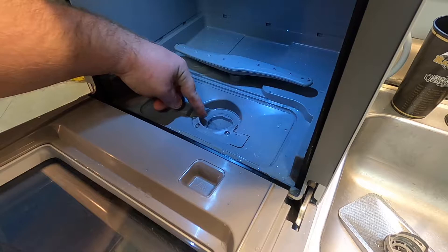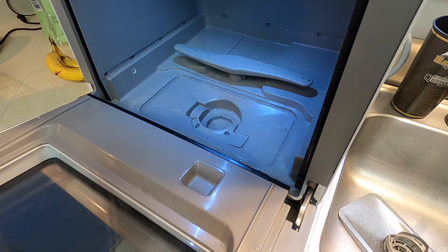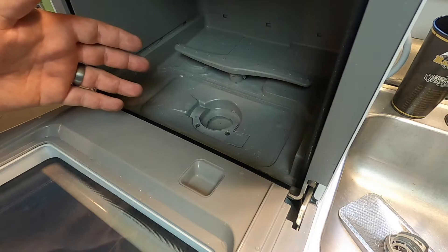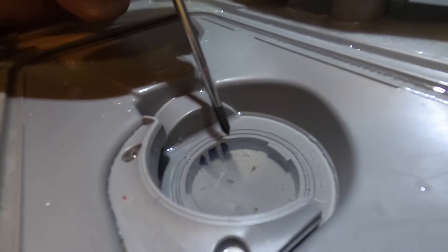I just let things settle as I was looking around in here, and lo and behold a piece of corn came out of one of these three little opening holes. Once I pulled that corn kernel out, I put everything back together, filled up for a new cycle, and unplugged the dishwasher. I wanted to do a full reset to give the dishwasher the best chance to figure out the problem and confirm that was the real issue with the drainage. Now I'll get a better shot down in here and wrap up the video.